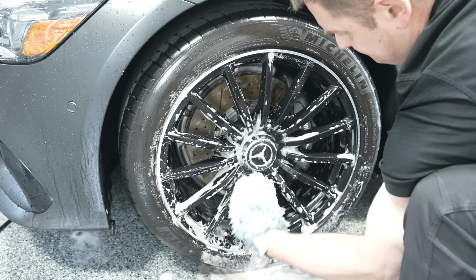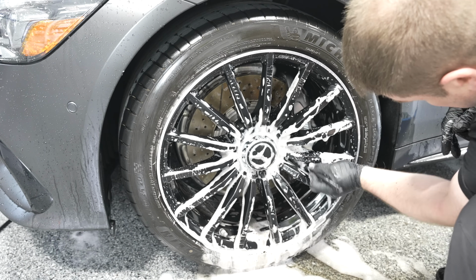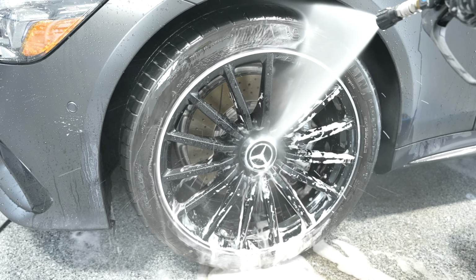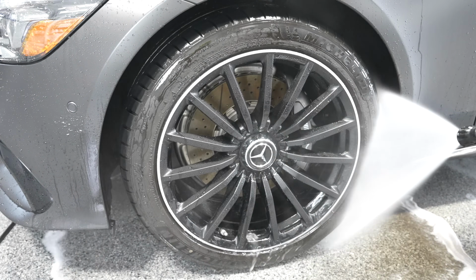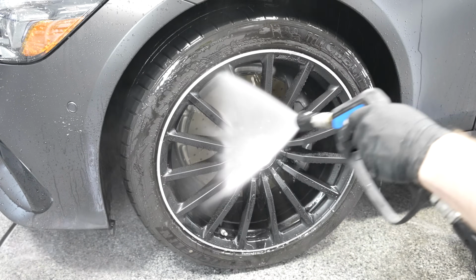If you get deep scratches, you cannot polish, because obviously polishing is flattening the surface. You're going to make it reflective and you're going to lose that matte appearance. So if you get into an accident or you have some deep, heavy scratches or gouges, you're going to have to go see a paint expert, and the panel needs to be repainted professionally, and it's a more complicated process. So definitely owning a matte vehicle, especially a matte finish paint job, is something you have to be aware of. It gets a bit more complicated.